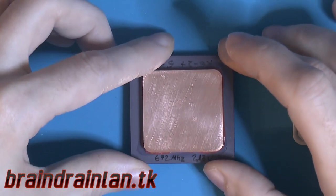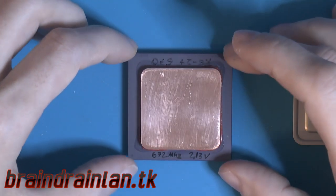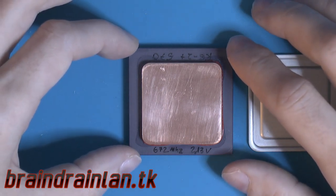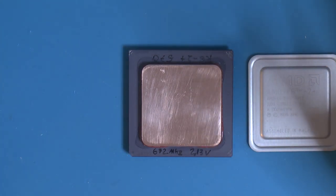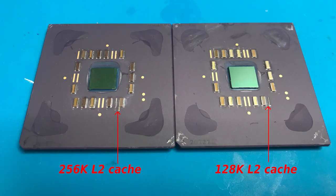So they're not rare — anyone who thinks the K62 Plus is rare, it's not. It doesn't mean you should destroy it, but it's not hard to find nor very expensive. So what we ended up doing was he bought three of them, I modded two of them and he sold one so we can get one each. Now let's talk about what we wanted to do — there's a mod on Vogons to turn the K62 Plus into a K63 Plus. The difference comes down to how much L2 cache is enabled: the K62 Plus has 128KB of L2 and the K63 Plus has 256KB. To enable the rest of the cache, you move a component on the chip.